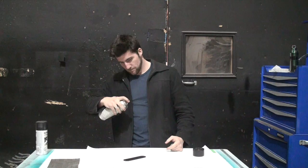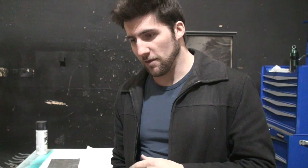I'm going to give that a couple of minutes to dry and then start actually painting. A lot of you are likely going to be painting with spray cans, and that's what I'm going to do on this particular piece. With adhesion promoter you don't have to let it dry, scuff it, or anything like that — you just go ahead and spray over it, whether you're using spray cans or something else. I often airbrush plastic pieces or use water-based paints with a paint gun. The adhesion promoter is helpful regardless, and sometimes I even use it in conjunction with a primer. It doesn't take long — I sprayed that about a minute and a half ago and I'm already ready to spray my paint.